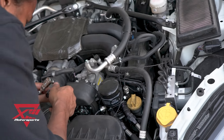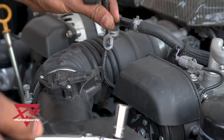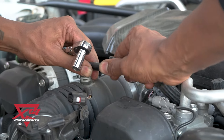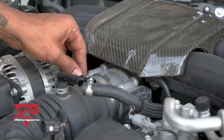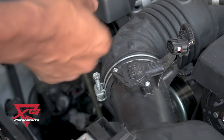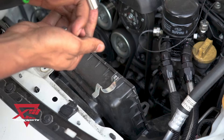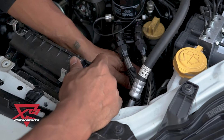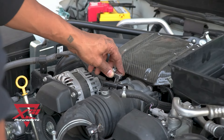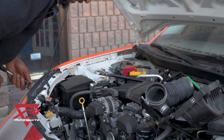Get this out and then this little clip here — you can use a socket sometimes, just push the tabs and it'll come right out. Then these hoses, the clamps are not super on there. If you got good fingers you can probably just push it off. Then there's a 10 mil here — or that's an 8 actually, not a 10. Take this off and then this whole thing should come out, giving us full access to this 10 mil. So 8 mil for this clamp right here. Disclaimer: I have not read the instructions whatsoever, so I'm just assuming this is how it goes.